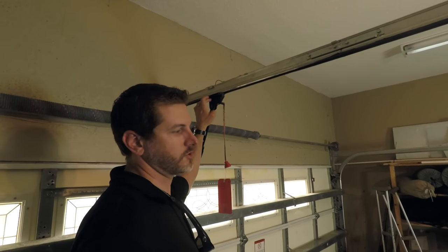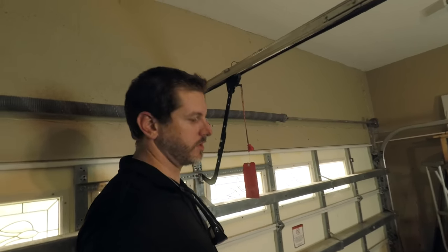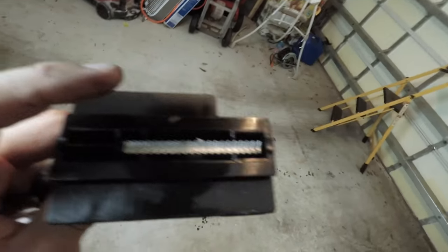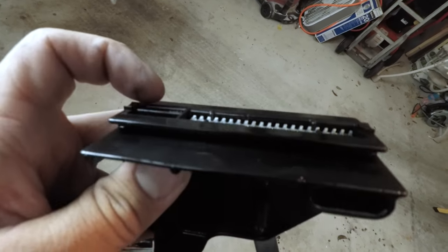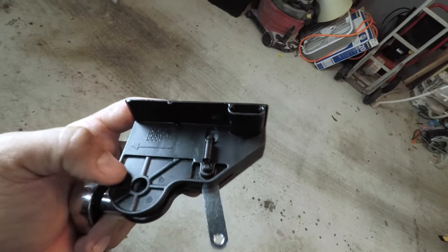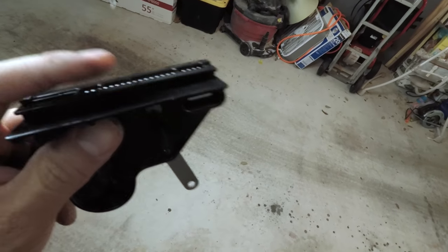The issue is this carriage right here. I'll show you on the new one the teeth and how they're basically ground down on this one. This is the replacement carriage — this is the actual drive piece that engages with the screw drive, the screw which is in this channel. All of these teeth, or part of these teeth, are ground down on the old one so it has no way to grab the screw and lift the door. We'll go ahead and replace it and I'll put a link in the description for this part on Amazon. This is just a Genie garage door opener with a screw drive, and this is the carriage for it.